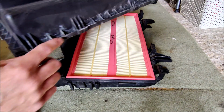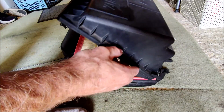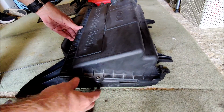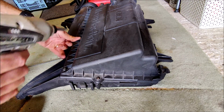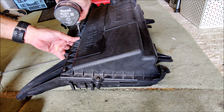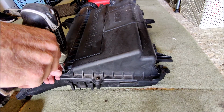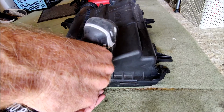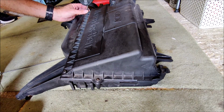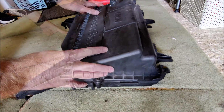and these hooks along the back go underneath these. Like that, and then gently you tighten the bolts back up, being careful not to overdo them as you'll strip the plastic thread, which I have admittedly done on that one there. Okay, these can go back in the motor.